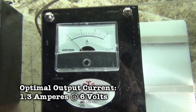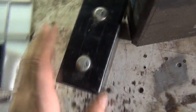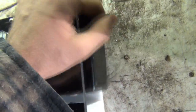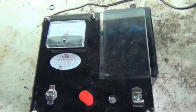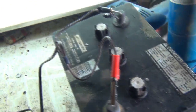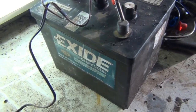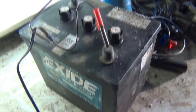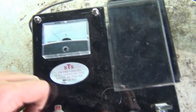Not a good idea to be any less, and doesn't really do you any good to be any more. This is a coil box tester. Basically you take your coil box, line up these two contacts and also the contact on the bottom, with the contacts in the tester. You hook it up to a 6 volt power source — the Model T runs on 6 volts — so this is my spare battery. Connect up your terminals like so, and then simply switch it on.